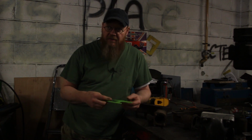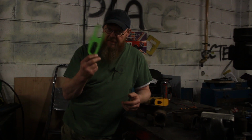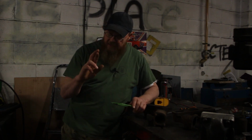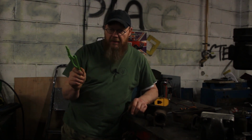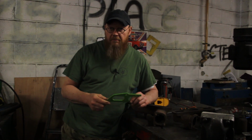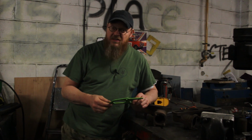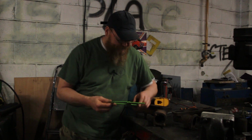I'm hoping that when I come down on Thursday, I'll have all these to check onto my manifolds. Hopefully they'll be correct, and then I can get those STL files sent off to a profile cutter, and they can be cut out of some 12mm mild steel plate, and then I can get on with doing the exhaust runners. So that's where we are with the Jag.